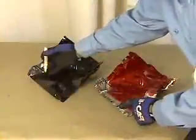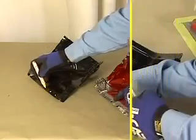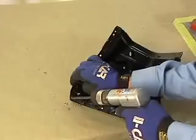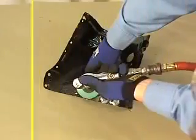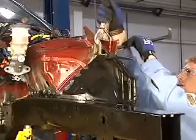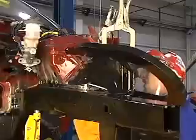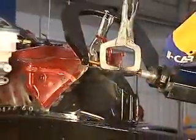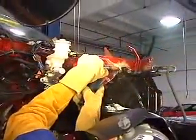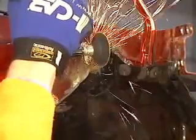Using the old apron front as a guide, the location of the welds are marked on the new part. Holes are drilled where GMA MIG plug welds are required, and coatings are removed where spot welds will be made. Next, the apron is clamped in position and spot welded to the frame rail, shock tower, and inner upper rail. The service procedure calls for GMA MIG plug welds in a couple of locations for the apron, so those are made next and dressed before installing the radiator core support.